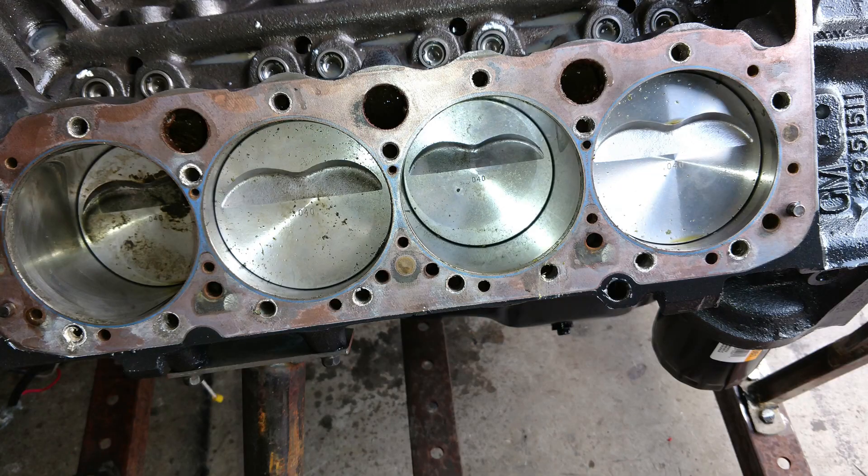When he had the heads off and was looking at it — if you look at all of the cylinders, the top of the pistons — we couldn't really tell if anything was damaged necessarily. There were bits of yellow rag all across all the cylinders; it kind of went through the top end of the motor a little bit. It didn't ruin the cam, didn't go down in the oil or mess up the bearings or the crank or anything like that. So that was good.